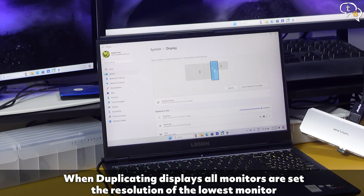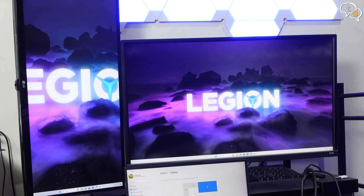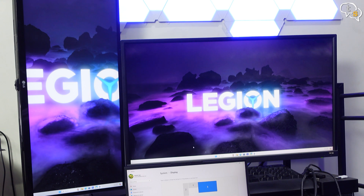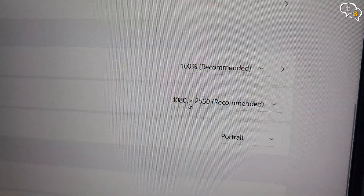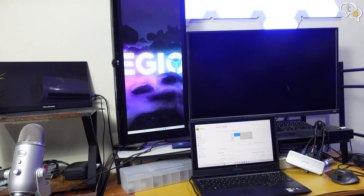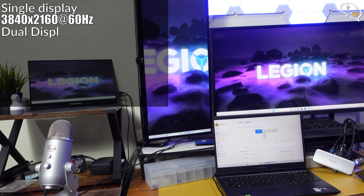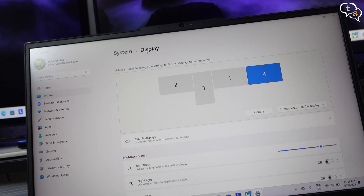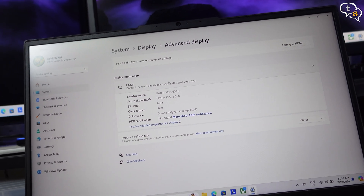Let's check out the resolution on each one. The wide monitor is to the left of the laptop and the 4K monitor is to the right. The 4K monitor is running at 4K with 2 monitors attached — that's a nice surprise. So in extended mode, we can have one 4K 60Hz monitor and the other at 1080p 60Hz. The vertical monitor is 2560 by 1080p. Now let's attach the third monitor, directly attached via HDMI. The display blinks and now all 3 are active. With all three external displays plus the laptop screen, the wide monitor runs at 2560 by 1080p, the external monitor at 1080p, and the 4K monitor is now running at 1080p. So triple displays off a single USB-C dongle is possible.